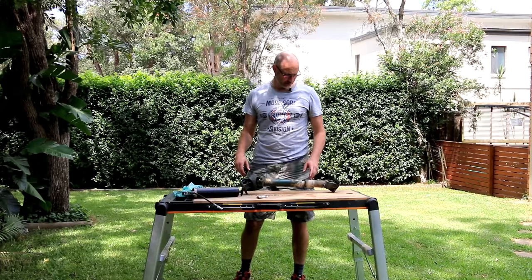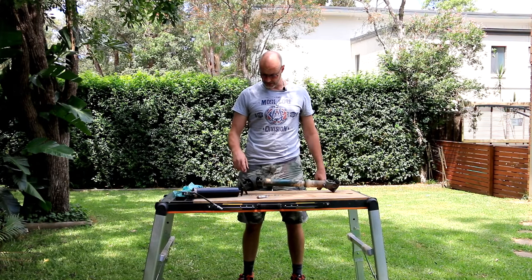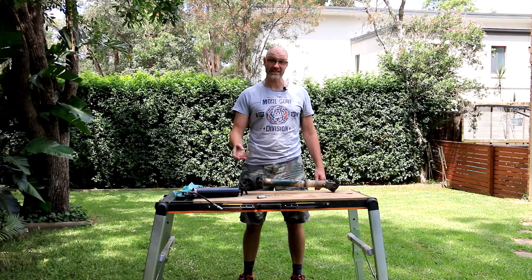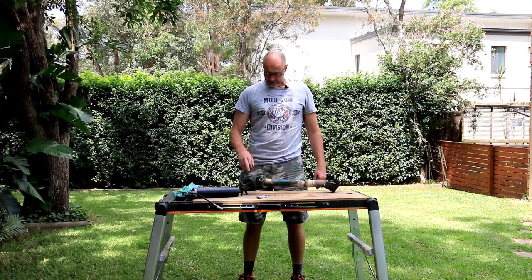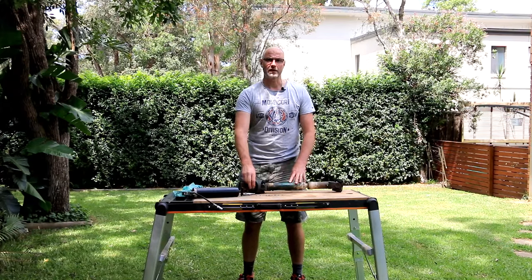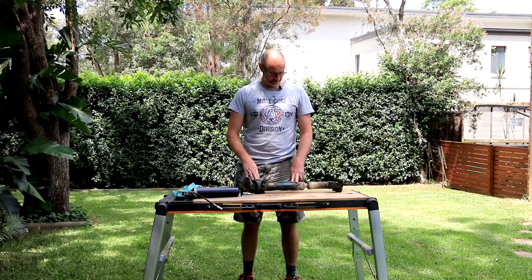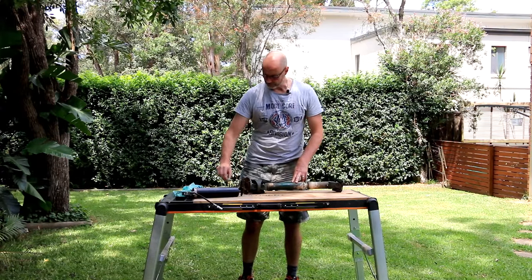One thing to consider is that you usually have to take off the drive shaft. You just can't access, or at least I can't on any of my trucks, the center grease nipple if the drive shaft is still on the truck. So it's a bit of a pain in the butt, but every 10,000 k's.